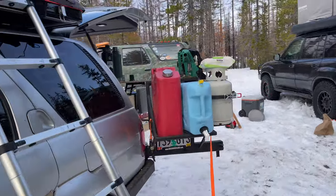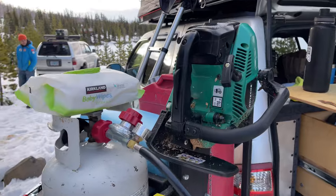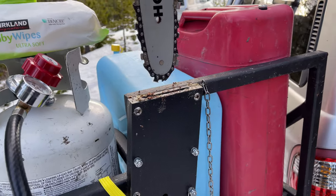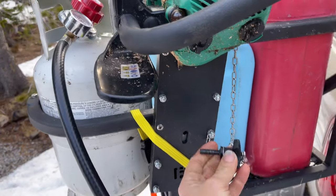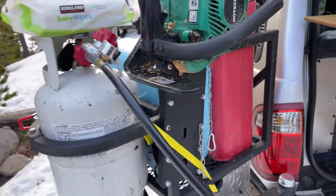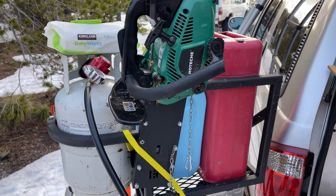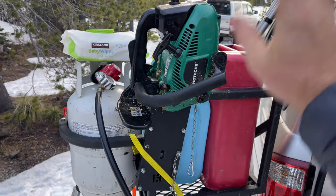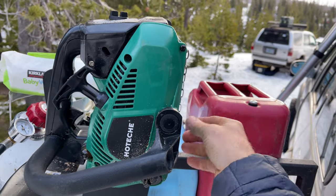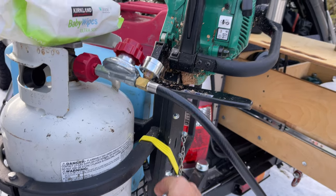Pretty basic light package. Rear kitchen has a swing-out with water, fuel, and propane. I'm going to drop down to the five-pound chainsaw holder bracket mount. I milled it out of HDPE — very nice, makes it easily accessible. It's secured because every chainsaw bar has a hole in it, so there's a matching hole — boom, there you go. I don't think it's a problem on the trail. We actually had to cut through a few trees on the way. I did a little safety chain link for it, and a bungee cord over it does the job just fine.